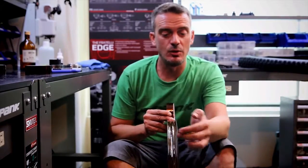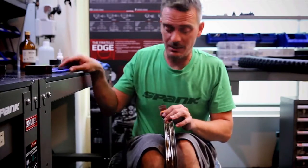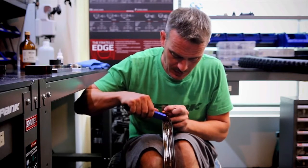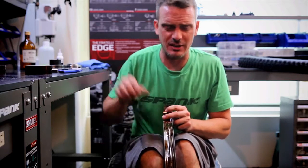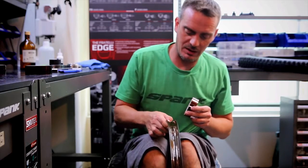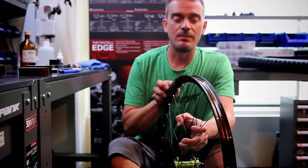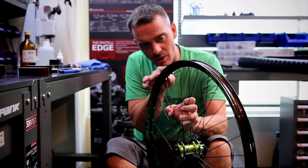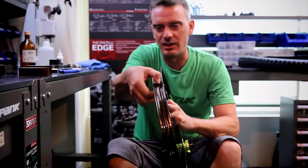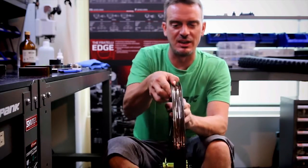Now that we've completed 2 complete revolutions around the rim, all the way to the left and right side, we're going to cut off the tape cleanly. Again, be careful not to get too much of your oil and grease from your fingers on it. And then simply inspect all the way around the rim, making sure the tape is pressed into all the grooves fully and adhered to the rim everywhere. Try to eliminate any large air bubbles you see.